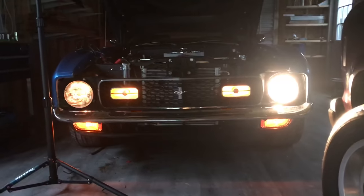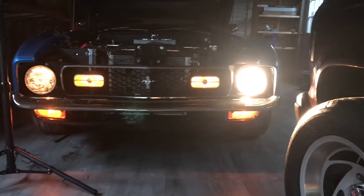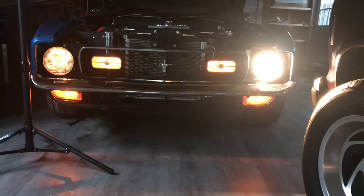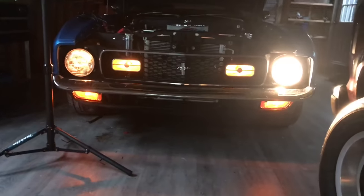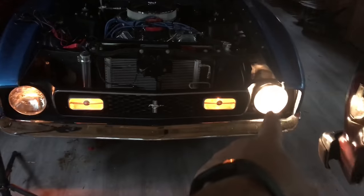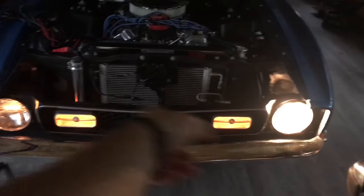You're watching this video because you got one dim headlight and one normal headlight. I'm going to cut to the chase and show you what everyone's talking about, or what you've maybe read on Google. This is caused by a bad ground — that's 90% of the cases. You can see the difference in brightness here, and this is such a simple fix, especially on these old cars.